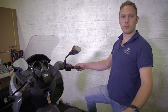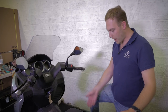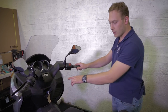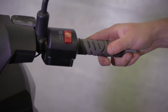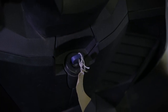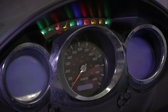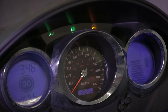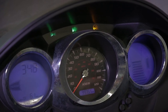There is a built-in self-calibration procedure. To invoke it, do the following: with the bike raised so the rear wheel is free to spin, the vehicle off, and the side stand elevated, apply full throttle and right brake. In this position, turn on the ignition key and wait until the service wrench light illuminates, then release the brake and throttle. The 'go' indicator will appear and the speedometer will move slightly. When it returns to the zero position, it is already calibrated.